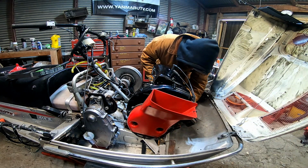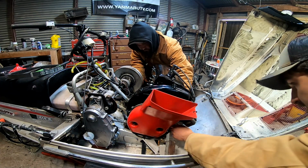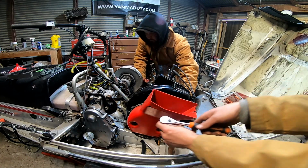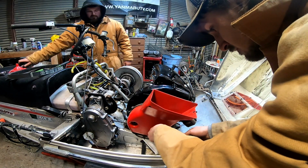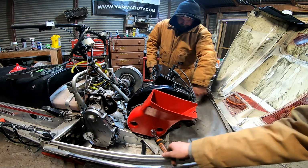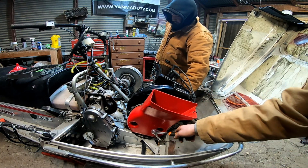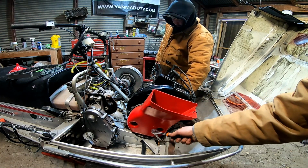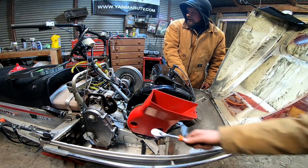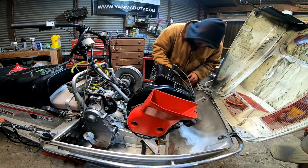I just don't want it to touch anything metal, not to compromise there. Should I put a little electrical tape on it? Good, not gonna hurt. Everything else looks good there. We got a ground strap, guys, from the engine to the chassis. We also have another ground up there, closer to the upper tunnel. And I got one over here from the tach. Yeah, we got plenty of grounds on this machine, and you never can have too many.